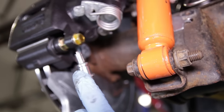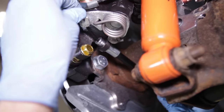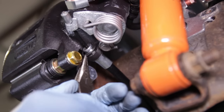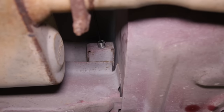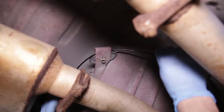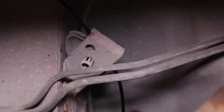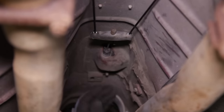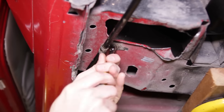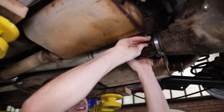Find the end of the included parking brake cable that has the small groove in it. This end will slide through the caliper and lock in place with the provided e-clip. Route the new cable in the same direction as the old cable. Pass it through the opening underneath the car and push the end of the cable toward the center of the car until the clips lock into place. Route the cable through the guides and then hook the other eyelet into the front parking brake cable. Do the same for the other side. Reinstall the cable-to-chassis retaining hooks. Reinstall the drive shaft and tighten the bolts.